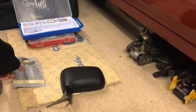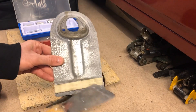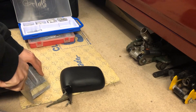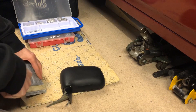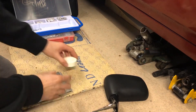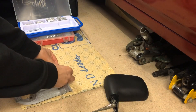Before I fit the mirror, I need to replace the double-sided sticky tape on the bracket that holds the mirror to the body. I've got a little scraper out and I'm going to go down into it - if I don't get it all off then I'll use some glue and tar remover to take off any residue. That's the bracket all cleaned up - still a little bit sticky, but I'm going to be putting new double-sided sticky tape on top of it anyway, so I'm just going to put it along here now.